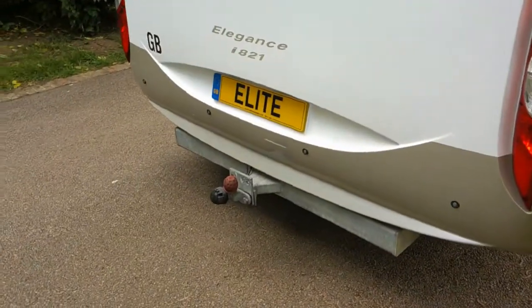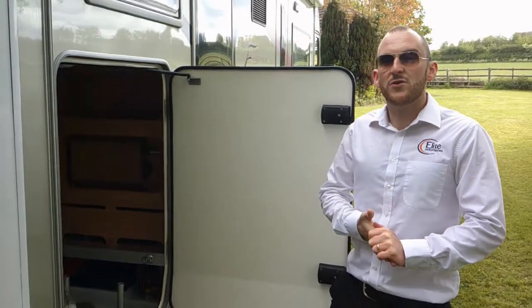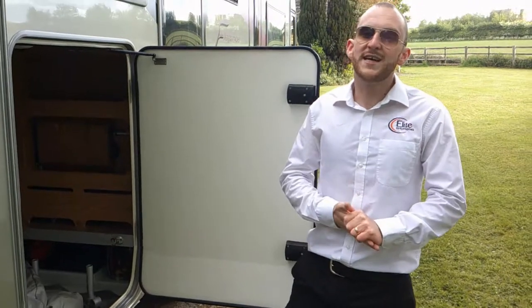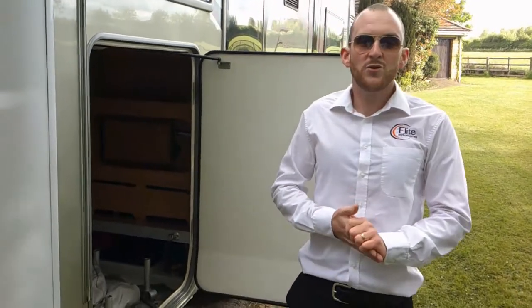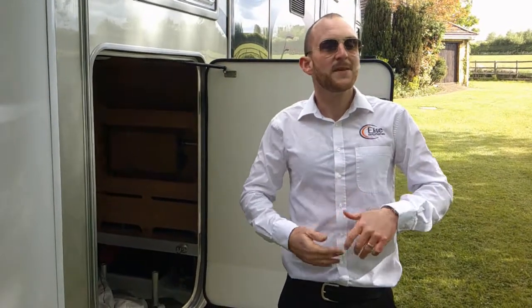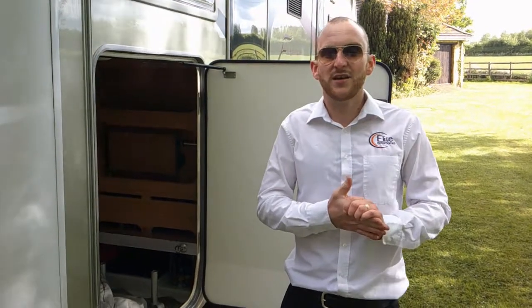This particular vehicle has had a tow bar fitted by a previous owner. There are a few valves to show you in here — you have the main on/off valve for your grey water, and there are also a couple of drain points for winterization. It's worth stressing — motorhome owners will already know this, but for first timers: your grey water tank is absolutely nothing to do with your toilet, sewage, or waste whatsoever. That all goes into a cassette which is further down the vehicle. Your grey water is basically all the water that goes down a plug hole — from your shower to your kitchen sink to your bathroom sink.